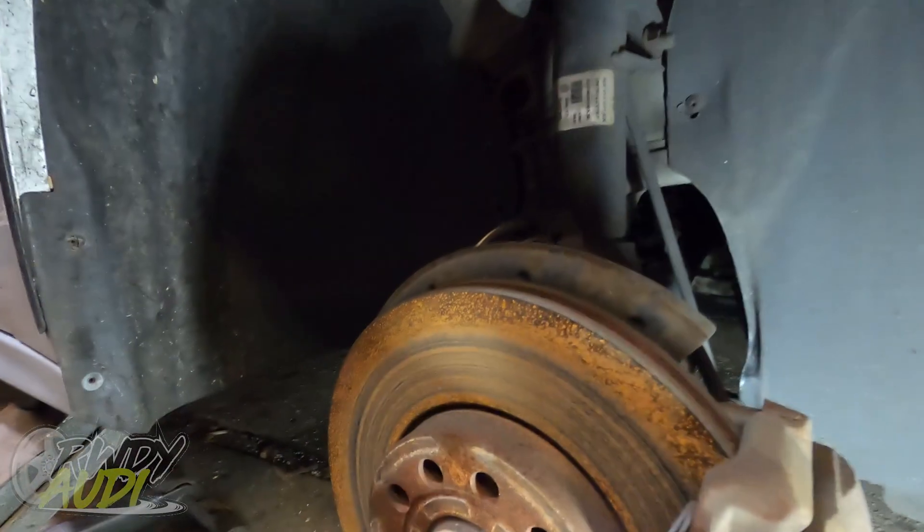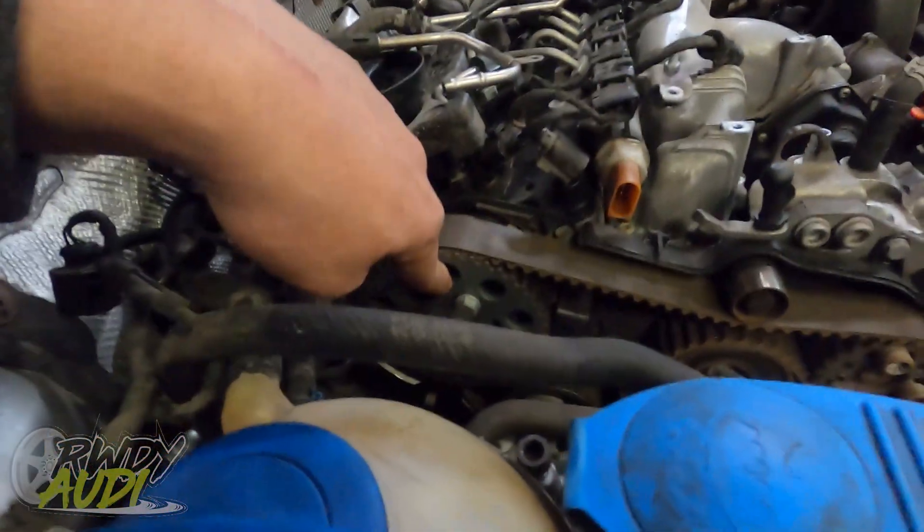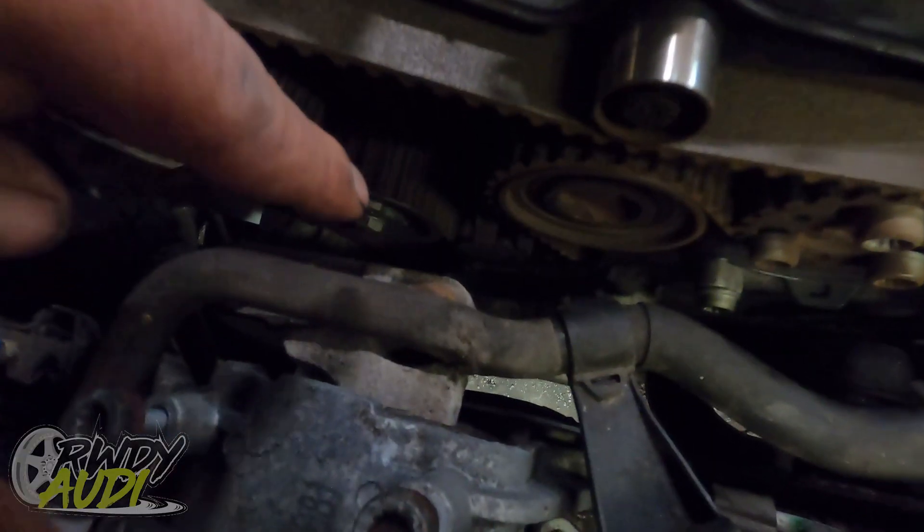Now that I'm educated — watched a couple quick tutorial videos, read some forum write-ups — the general gist is we've got to take this liner out to get down to the pump, set the TDC, and then there are some marks on the crank pulley we've got to line up. That little notch lines up with the crank. Got a game plan, let's go after it.